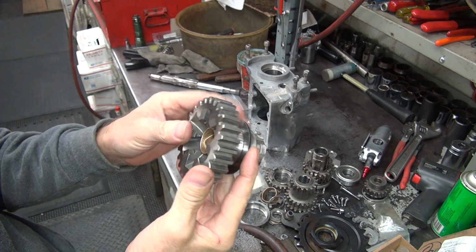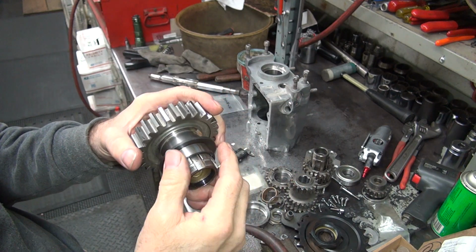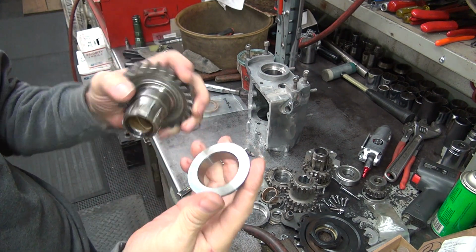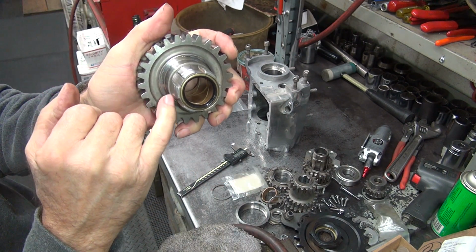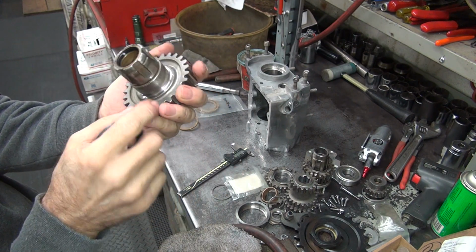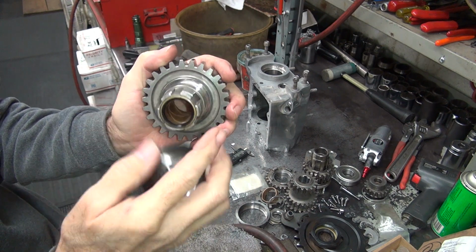So usually when I buy new parts, I like buying the Andrews gear because it has that O-ring in it. Nobody else does that. So other than that, there's no real fix for this except make sure it's good. Make sure this surface is nice and smooth because it has to seal against this surface right here. If there's any kind of lips in this or rough machining, it can leak past those grooves. So always make sure the surfaces are good. This, you can't do much about, it is what it is.